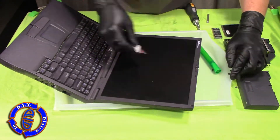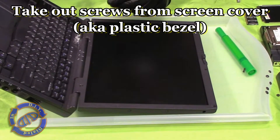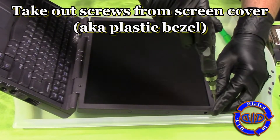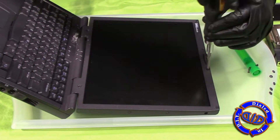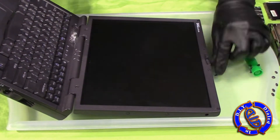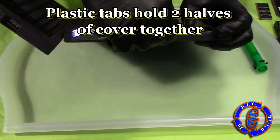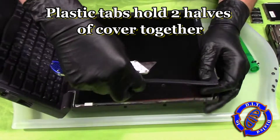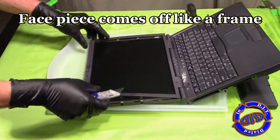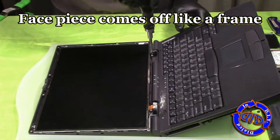For now I'm moving on to the LCD screen. I'm gonna get all the covers over the screw holes taken out so I can start getting out all the screws that hold the plastic bezel over top of the LCD screen. In case you're curious about that green highlighter off to the side — it's actually no longer being used as a highlighter. It's been cleaned out and repurposed; I showed you in a previous video how I turned it into a magnet pen, which is great for projects like this where you want to make sure you don't lose little parts like screws. I'll put a link in the description below.